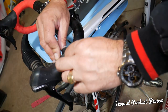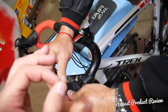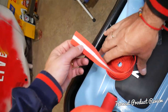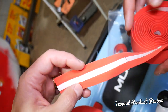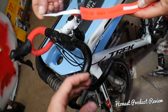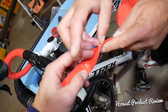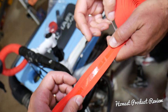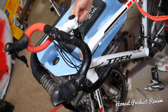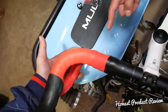We're going to go ahead and install this one and show you what it looks like. First, flip everything on the bike and clean your handlebars really well. The big advantage for this tape is it has a double-sided tape on the bottom, so it's going to self-glue itself to the handlebars. Sometimes that tape will be really stuck, so just start it on one end and keep going — don't touch the tape itself.